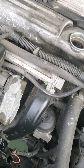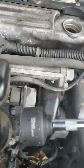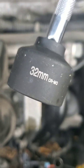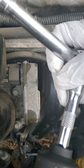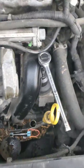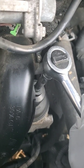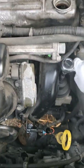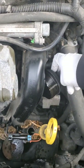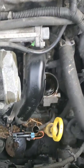While the motor oil is draining, go ahead and remove the oil filter. You're going to need a 32 millimeter oil filter cover socket and a ratchet. I recommend a small extension — not too big. Set the cap somewhere safe and here's the oil filter.